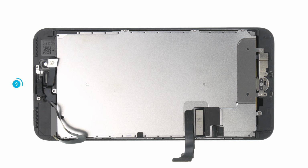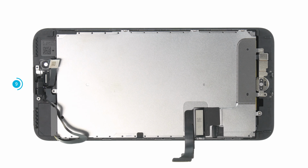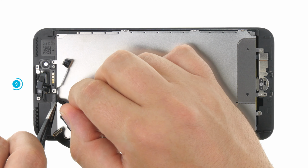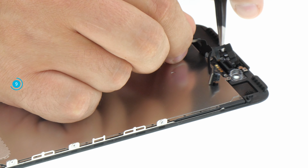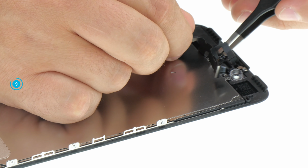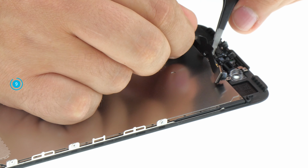You can use hot air again to loosen the glue more easily. Loosen all parts bit by bit. Start with the sensors and lever them out of their guide. Then loosen the flex cable that is glued to the display. Gently slide a pair of tweezers or a steel spatula under the entire cable and contacts. When everything is loose, you can remove the cable assembly.